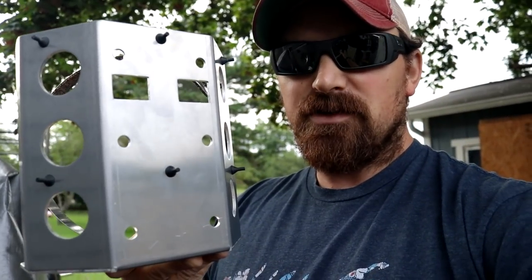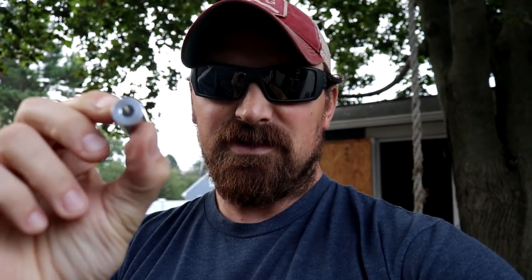What's going on everybody? Today is Friday morning, so this is part two of mounting the propane tank to the Gobi rack. I got my power tank propane mount bracket in last night — so it's this guy. It's actually a little shorter than I thought, so I have to do some adjustments to the horizontals I put on the Gobi rack already. The other piece I needed was these little one inch barrel aluminum spacers. I'm going to adjust the horizontals, mark the four holes, drill those out, and get this all mounted up. Gotta do this quick because we're leaving tomorrow morning.